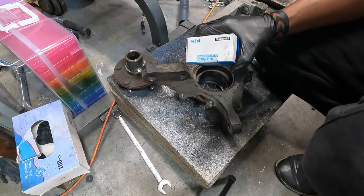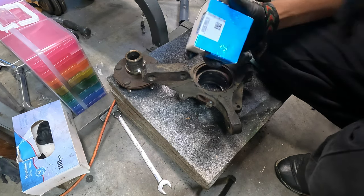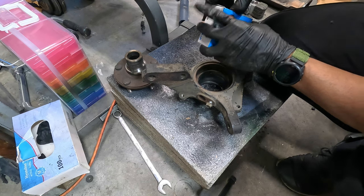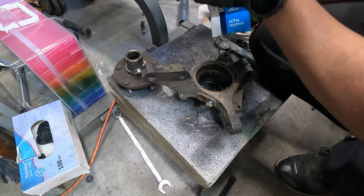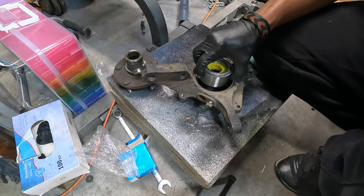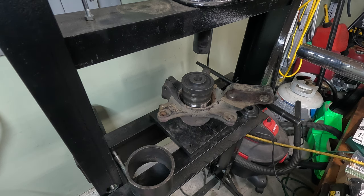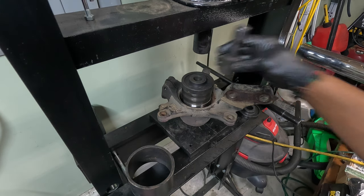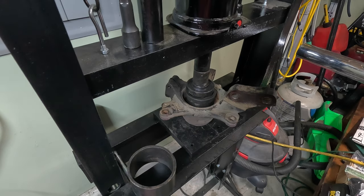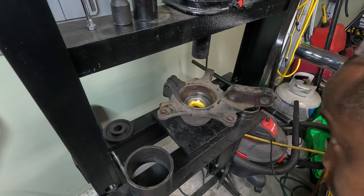These are the bearings I'm using — I got them from fastwrx.com, NTN brand. You can see the part number; I'll put a link in the description. Here is the new bearing — it's going to go in right here just like that, and it sits nicely. I have the old race, some bearing installed plates, and I need something to make up the space. I'm going to stop and check it to see if I'm all the way through — and it looks like I did get it all the way through.